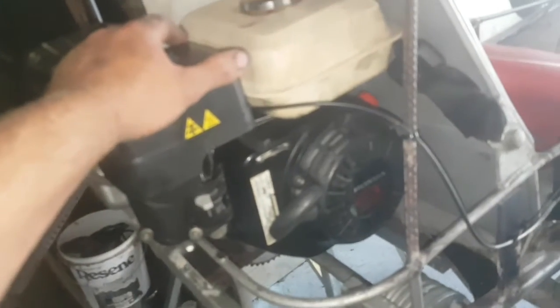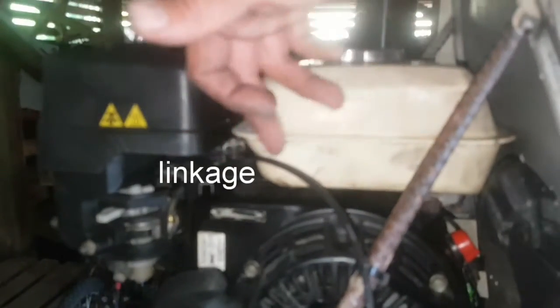Love it. Things in place. This is the first time we've had the engine back together since I bought it. I started it up when I first got it, haven't started it since, but I've just set it up, put it in place roughly and set it up with the throttle, and I'm just quite interested and keen to see how she goes. So I took the governor out, rearranged the throttle situation, so it's got an extra connector push rod kind of thing to the accelerator.